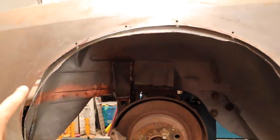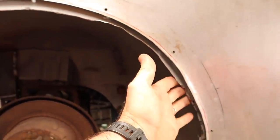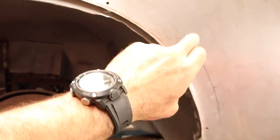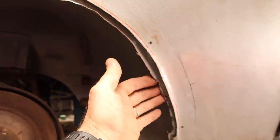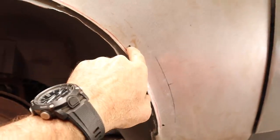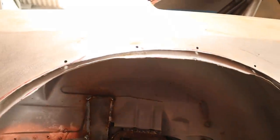I've trimmed out the inner and outer skin. I was trying to panel beat the inner skin over but it's hard — I can't get a dolly onto the back edge of the inner skin very easily. Looking at it, I think the easiest way to bring these two together and fill this out nicely — I have a really nice bolting position for these bolts, double skinned all the way around — is to go inside the arch and trim it on the inside of this line all the way around. Then I can place the outer piece exactly where I want it and put a patch piece all the way through. I think that's something I'm going to do when I get it on the rotisserie because as it is it's going to be difficult to get to.